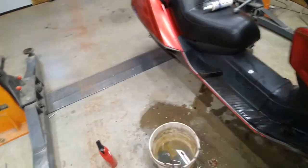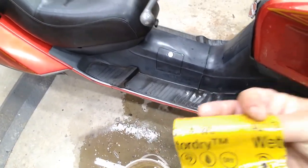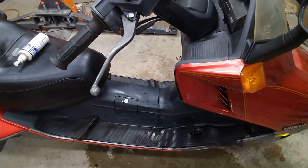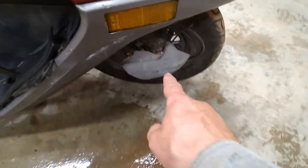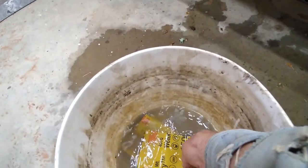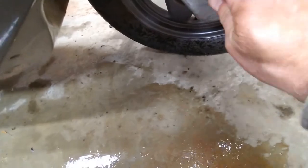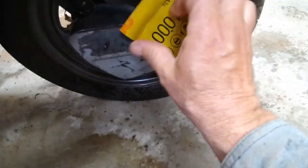Here's what I did. For cleaning up the plastic, that's 2000 grit — wet sand it, and it doesn't take long. You just go 1000 grit, 1500 grit, and then 2000 grit, and just wet sand it. That takes all that weathered stuff off the outside. Here's 1000 grit right here — don't be scared of the water. It doesn't take long to get all that stuff off of there.